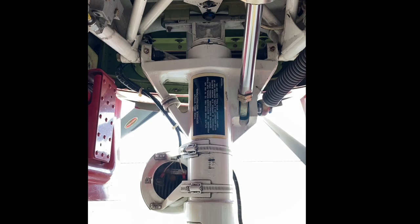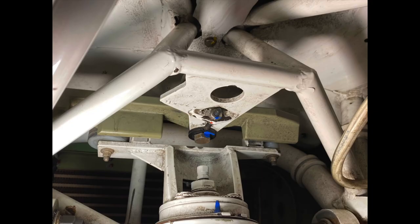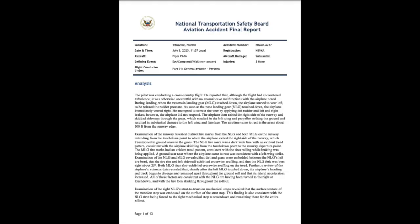It's fairly clear that damage to the steering from towing has been the cause of some runway excursions. Tow damage occurs when the tug operator turns the nose gear beyond the 30-degree limit. Damage from oversteering changes the gap between the steering horn and the steering arm by bending something or breaking the steering horn loose from the nose gear. If you suspect a problem, look at the steering horn and steering arm to make sure they are intact, and check the three bolts that hold the steering arm to the nose gear assembly. A recent NTSB report showed how these bolts can be sheared, leaving your steering literally hanging by a thread.